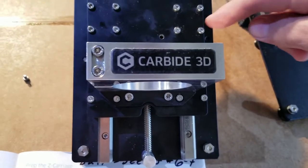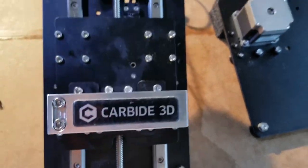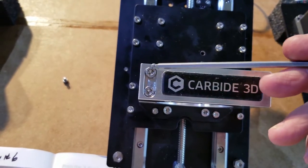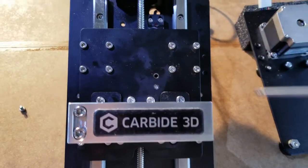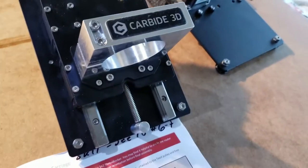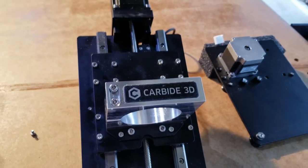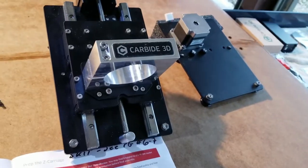I've got all four bolts installed and I did use the cross pattern to tighten them down in several steps. I installed these guys right here. Yes, I did put WD-40 on everything. This one right here was a little bit hard. I'm telling you, WD-40 or a little bit of household oil is going to make your life a lot easier because you'll know when it's going in smooth or if you're cross threading. If you're not using any kind of oil, it's hard to tell if you're cross threading something.